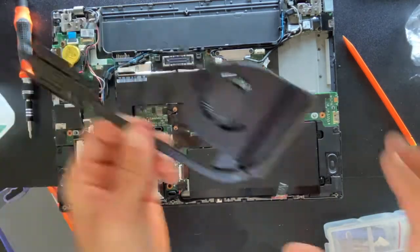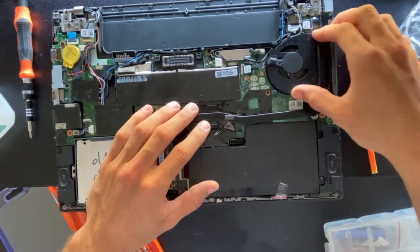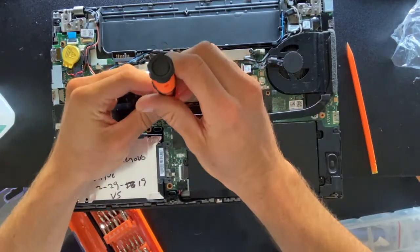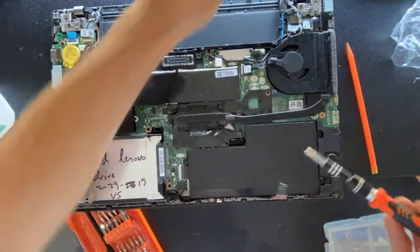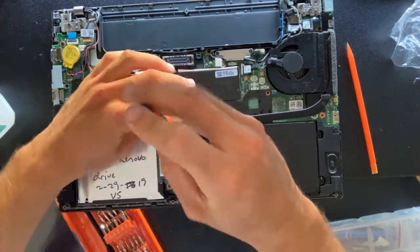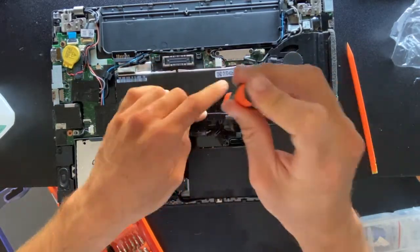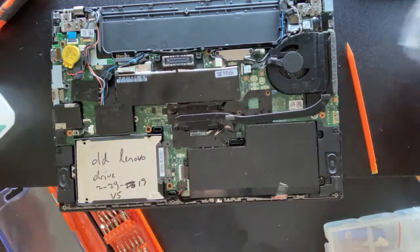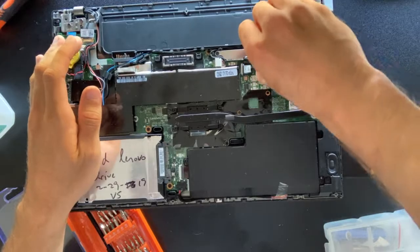Once we do all this, it's basically pretty simple — you just place the cooler back on. You can jiggle it slightly to ensure good thermal contact between the surface of the chip, the thermal compound, and the copper heatsink. Then thread the Phillips screws back onto the CPU cooler. These were torqued on pretty hard, so I torqued them back similarly to match Lenovo's original torque spec, pressing the cooler firmly onto the CPU. Then reconnect the fan cable to the motherboard.